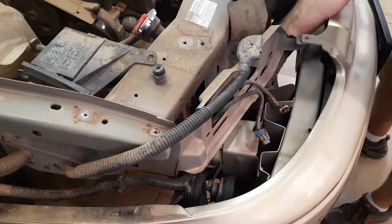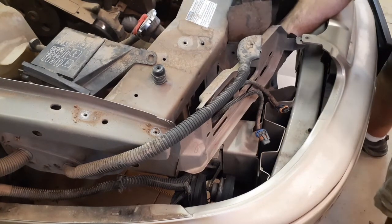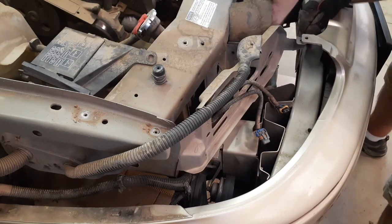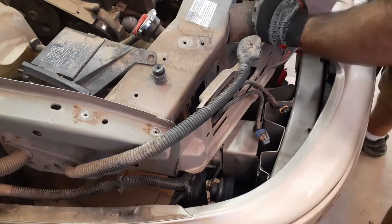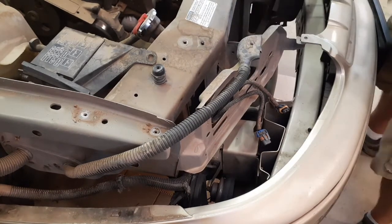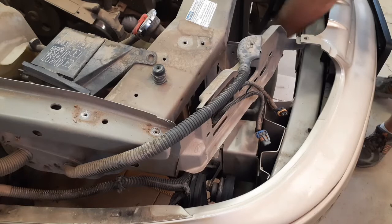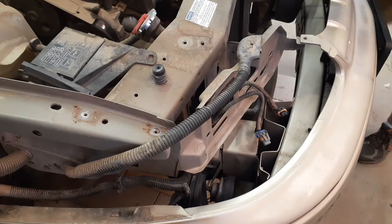Top off of them. If I just take the rest of it, try and get it out. But if it doesn't, just force it out with a pair of cutting nips. Replace it, it's just a little plastic bit. And I can see screws, or bolts, down below there, tying the bottom of the bumper in, the air intake. I want to get that off before I do that last bolt.